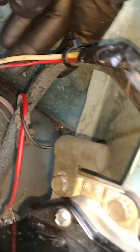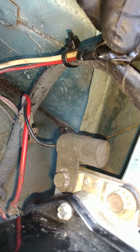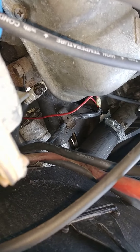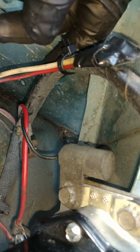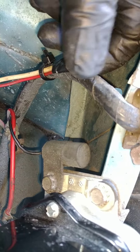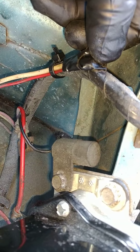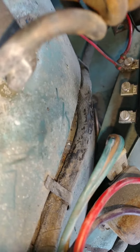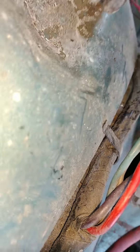When it comes to that original wiring, this white wire coming off the splice is the one that now turns red. This is the one that goes directly to the generator gauge. I had to go online and look for a wiring diagram to see where the light went, and that should be right — that should turn it on properly. I sure hope so. I'm gonna find out, or it'll be reversed, which is not a good thing either, but I'll figure it out later.